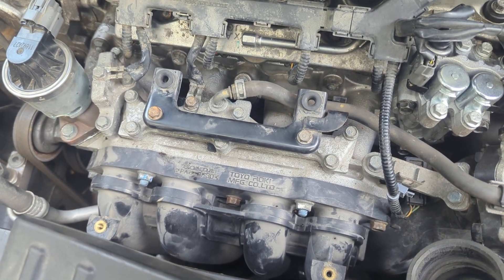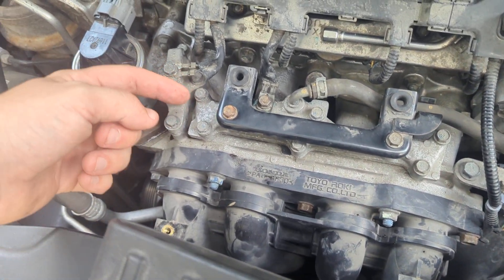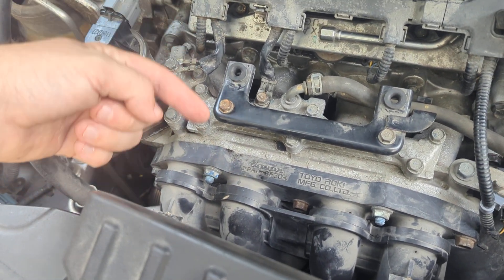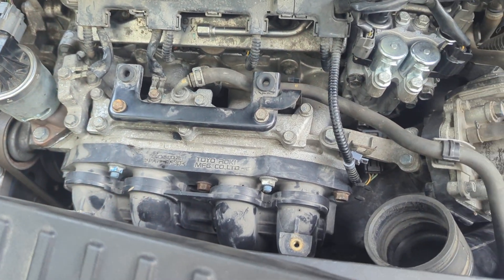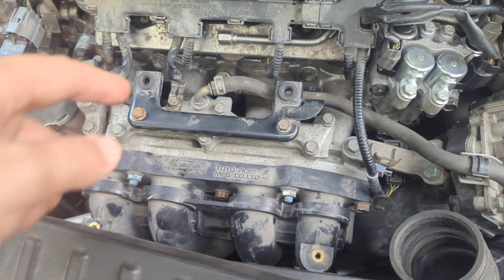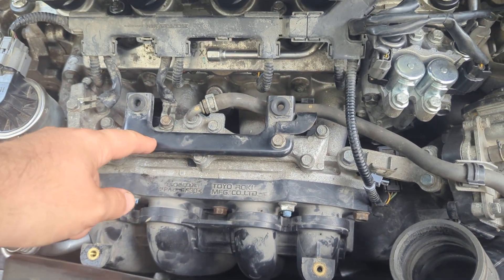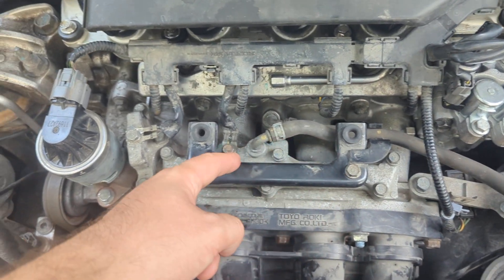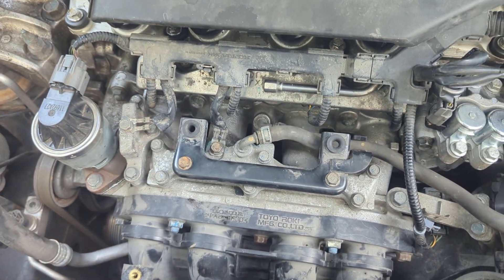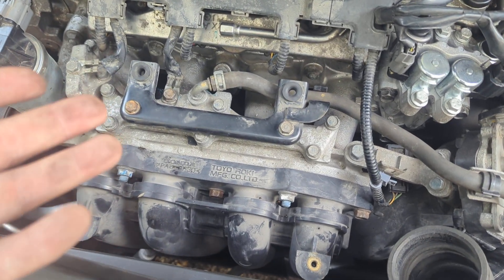You're supposed to do it every so often, like every couple of years. Carbon builds up because this air gets taken and put right back into the engine — it's part of the exhaust. After I cleaned this out, it was clogged here. There are four holes and they go into the cylinders. My mixture was running lean, so now I've cleaned it out.